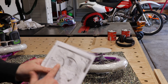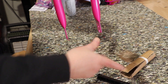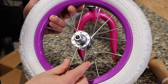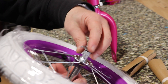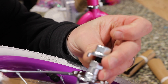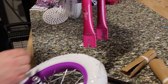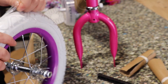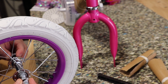The first thing is installing the front wheel. This is the front fork of the bike. You can take this little protector out and then slip these cardboard covers off. Here's the front wheel. Loosen up these nuts — you don't need to take them all the way off. There is a little washer with a hook on there that's very important. You'll notice the forks have a little hook on there as well. You want to put those in that way so that if, for some reason, you didn't tighten it tight enough, the wheel would still stay on and not fall off the bike.